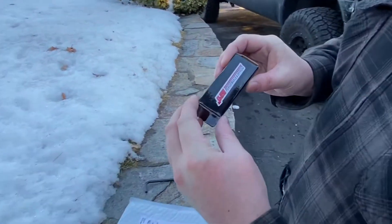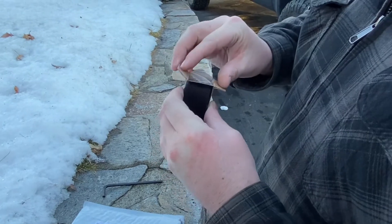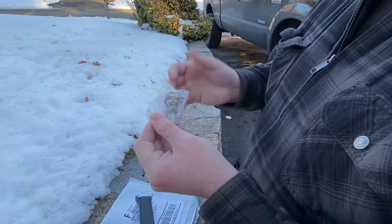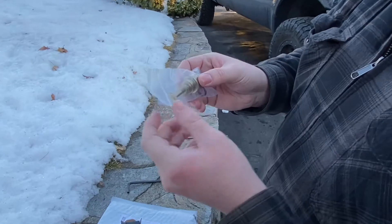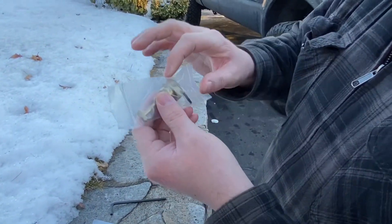From Swag Performance Off-Road, we got this nifty little drain plug here. This goes on your HFCM, which is technically your lift pump. Basically what you're going to do — you put the O-ring over here, take your old drain plug out, and put this new one in. It's knurled.